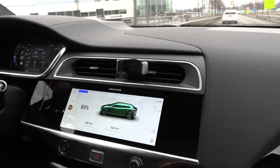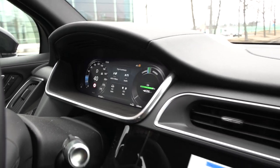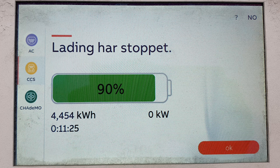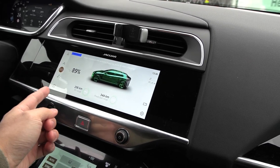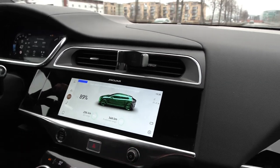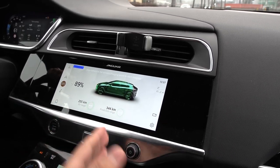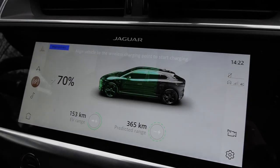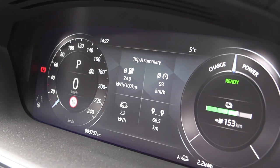We're on the move at 89%. We stopped charging at 90% exactly, just like with the wireless charging. We reset the trip meter. From the screenshot, the charger delivered about 4.5 kilowatt hours just to add 4%. That's what I notice with the I-PACE — the further up towards 100% you go, the more energy-dense each percent is. So we need to measure how much energy we actually spend from 90 down to 70 percent — not based on the whole scale because it's not linear.